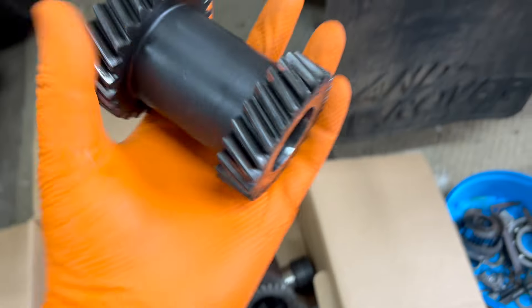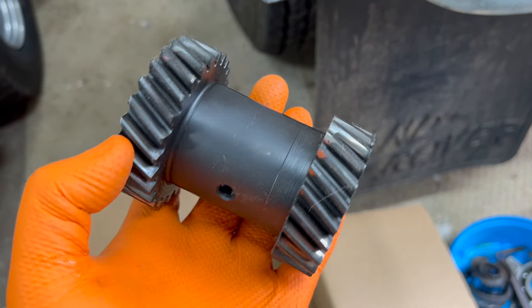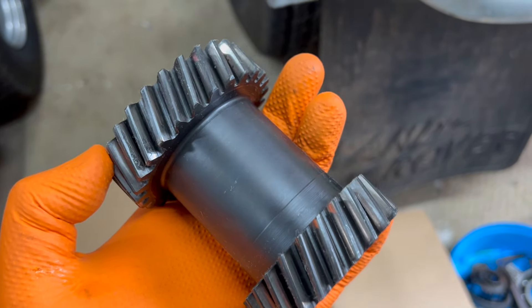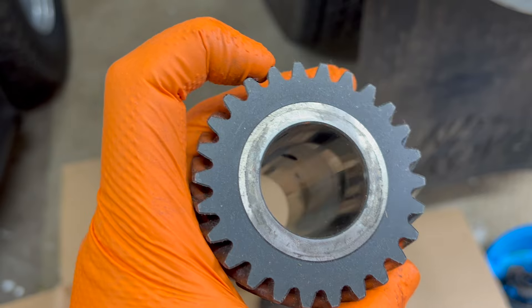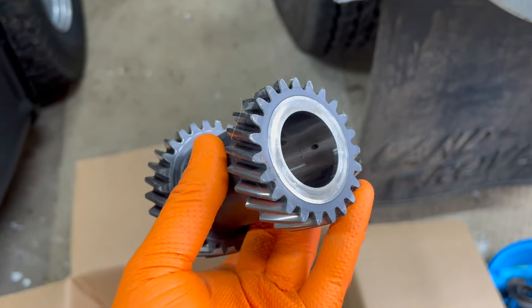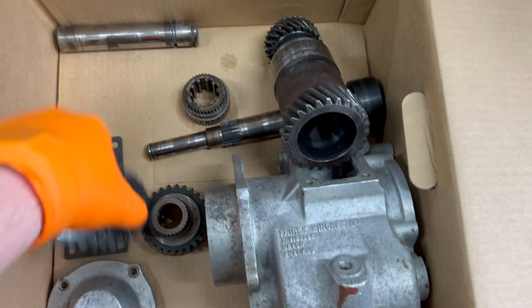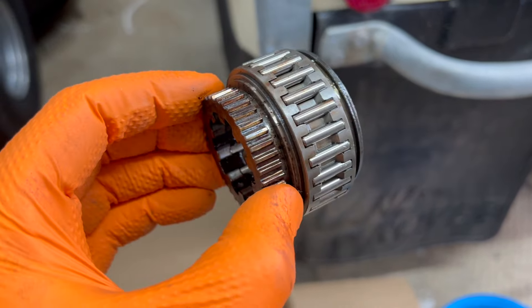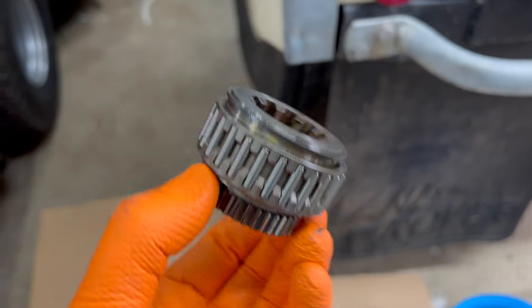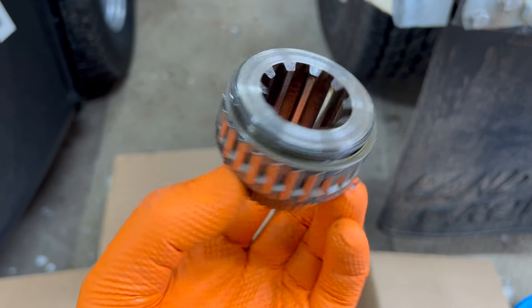This is the lay gear itself — actually it's not too bad. There's maybe a little bit of wear on the teeth, but for the price of a new one I'm probably going to chance reusing it. Those surfaces are pretty good — maybe a little bit of pitting — but I think I'll be reusing that. This is, I think it's called the clutch assembly. It lives in the transfer case and is absolutely fine — thank goodness, because I think that's about £50 or £60 and they are of variable availability, sometimes available, sometimes not. So I'll reuse that.